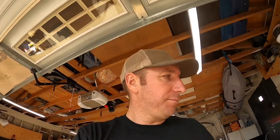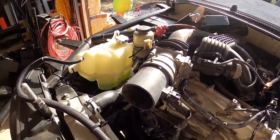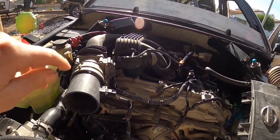We can run this thing off battery power. I got a new throttle body, going to put that in — straight to the intake — and see if that fixes the problem. When you press the throttle you hear it go tick tick tick like it's not trying to do anything. It sounds like it's trying to move the butterfly but it doesn't. If you move it manually it revs right up normally, so the ECU is telling it to do it but it's not doing it. Let's try and fix that.